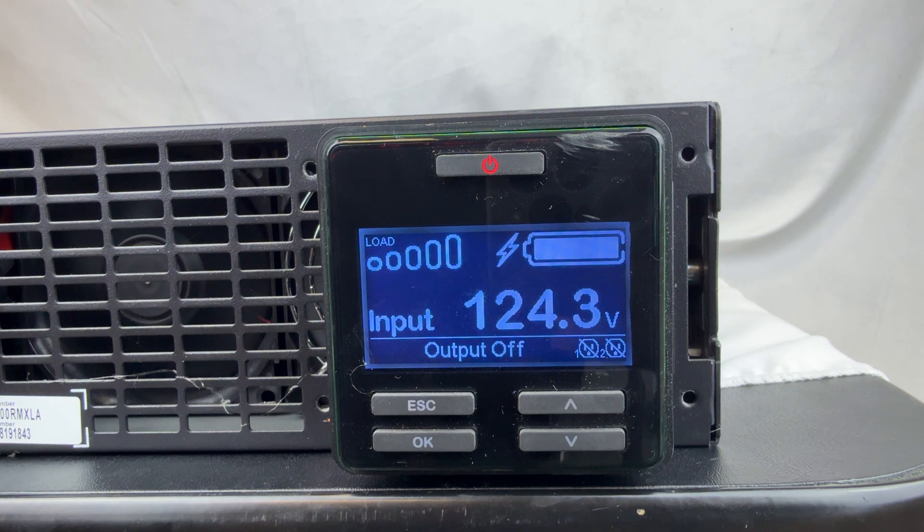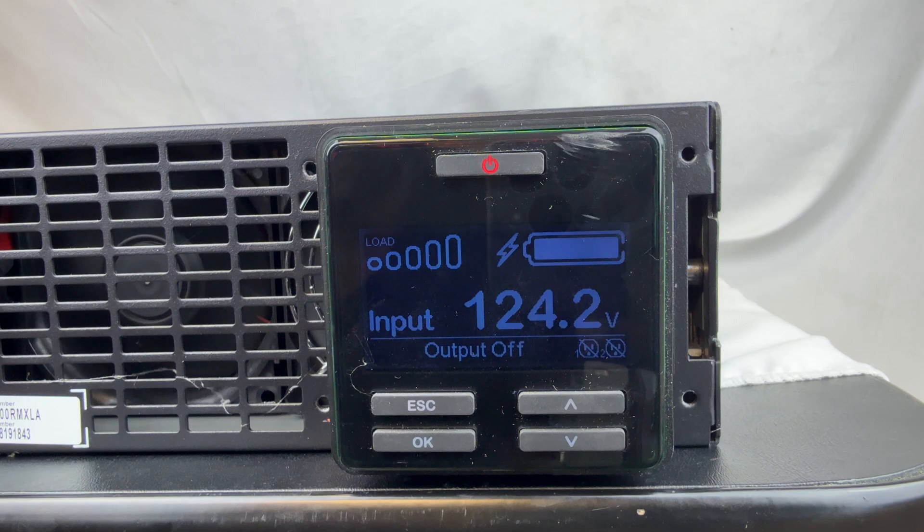In today's video, we'll be showing you how to update the install and RBC battery date within a smart APC unit. This is the number one most common misstep during the installation process, which results in the replaced battery light not being reset by the UPS unit. Every two weeks, the unit is programmed to run a self-test where it puts a 10-second load onto the internal battery cartridge, checking that the battery is charging properly and voltages meet the manufacturer's specification under a specific load.